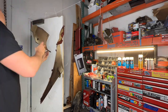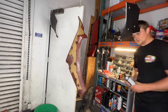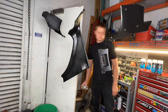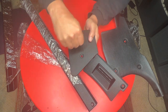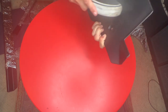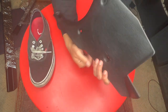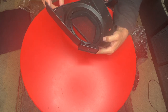Always remember that a very thorough prep will lead to a much better result. Not all plastics are the same, which means some plastics from the car accept the paint better than others. The harder plastics took the paint really well — items like the lower dash trim or this random corner dash cover. I could really scratch away with my fingernail but the paint remained. As the plastics got softer or flimsier, like the kick panels, the paint wouldn't stick as well. Also, plastics with a very smooth texture did not hold the paint well at all.